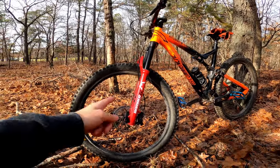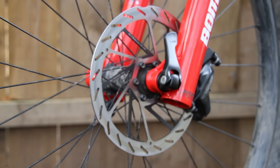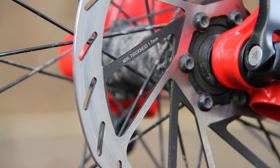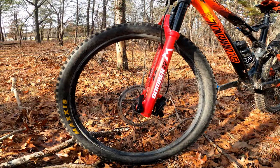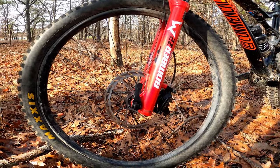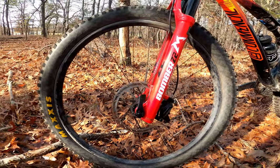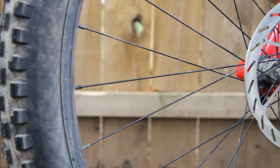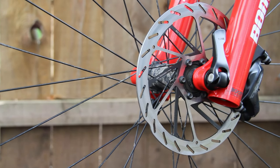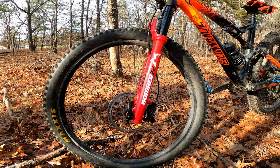In addition to that I got these new HS2 Ceram rotors that are 180mm and they're thicker than the previous Centerline rotors. They've got some kind of thermal dissipating heat paint on the darker spot here. The rotor itself is now 2 millimeters thick and the track pad is a different shape. They claim 7% more power than the regular Centerline rotors with the G2 brakes.